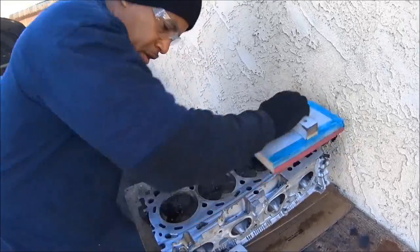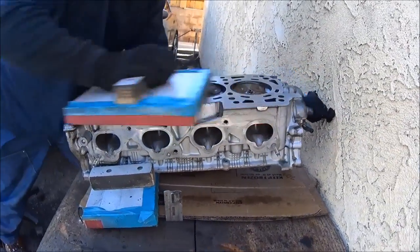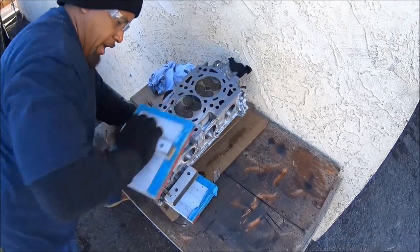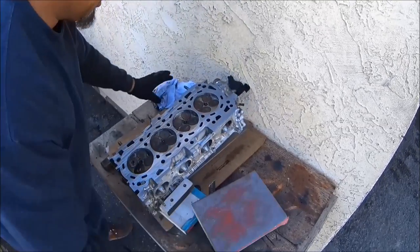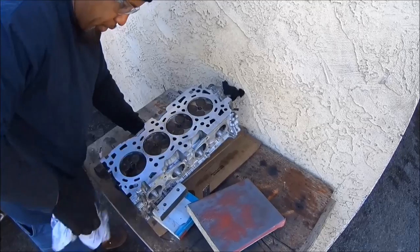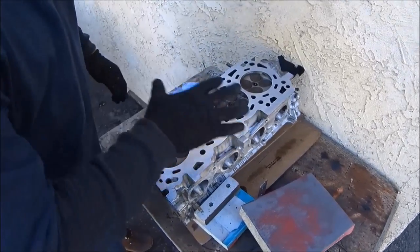Make sure when you do this you go all the way from end to end. That's how fast — look at how much material we just took off. I'm moving the block and also angling it at the same time. We are slowly taking up material, little by little. All that gasket material is gone but we're not done sanding yet.